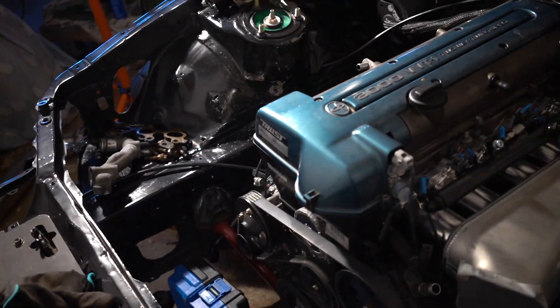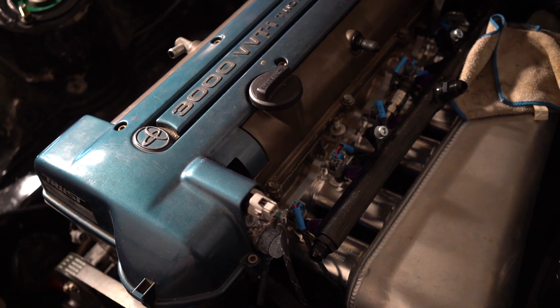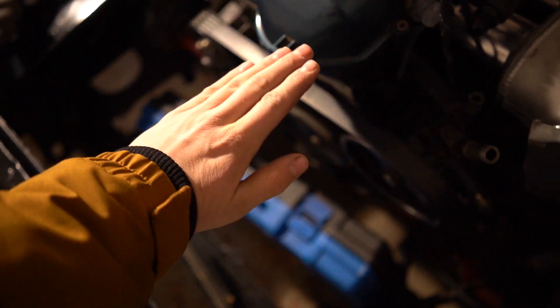To sum it up: I'm waiting for a new manifold so I can put the turbo on, put the wastegates on, get my exhaust welded up and modified, put that on, get some dump tubes, and get this whole side of the car done. Then hook up the intercooler, and after that I'll go with the IS300 radiator. They make a radiator shroud kit for the Supra with electric fans instead of the mechanical fan — that'll really open up the engine bay in front. Electric fans are actually more efficient too.